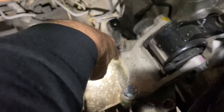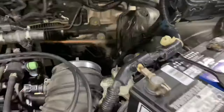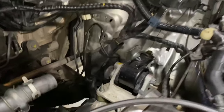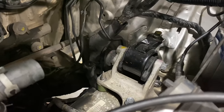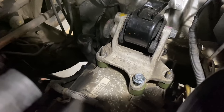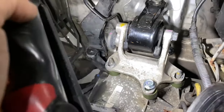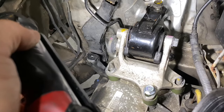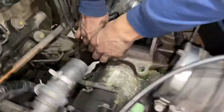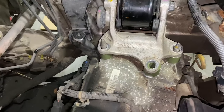Don't be alarmed about this barely sticking out — once you tighten everything up there's plenty of thread engagement. One thing to note: you don't want to put this kit on if you've already done engine spacers. The quarter-inch engine spacers you have to take those out to install this kit. There's not enough thread to do both the one-inch and the quarter-inch engine spacer kit.